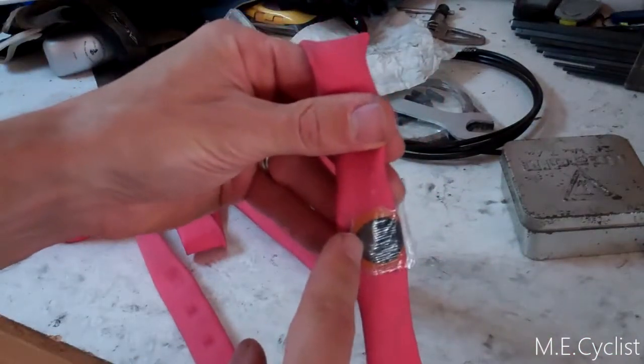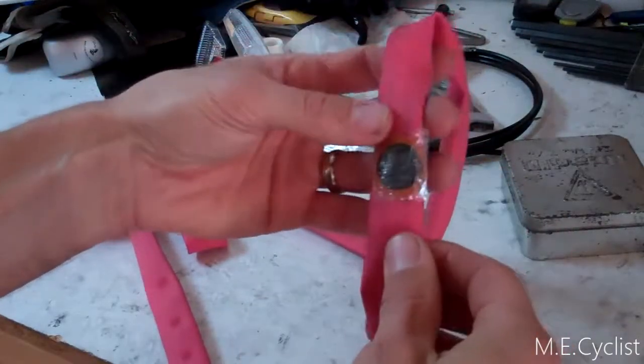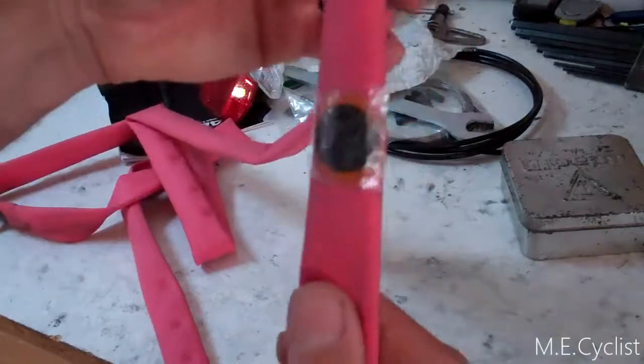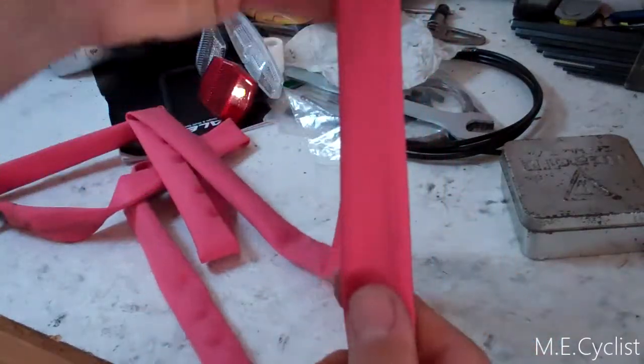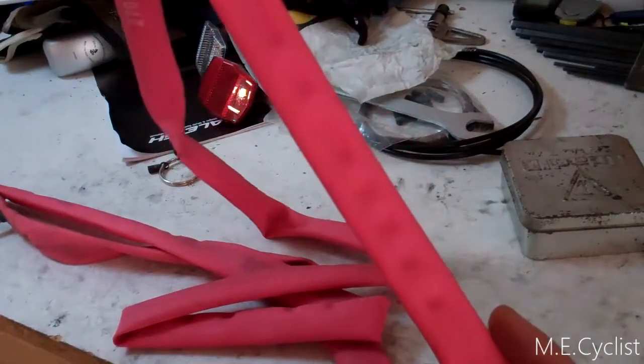Oh, and by the way, this tube does have one patch on it. And you can use the normal patches, so if you do learn one thing from this video, know that you can use the normal patches on a latex tube. That's just your standard patch, so that does work. But there's some more of that wrinkling effect you see there.